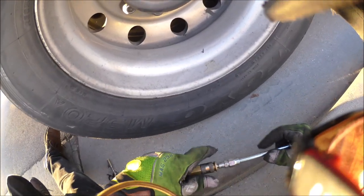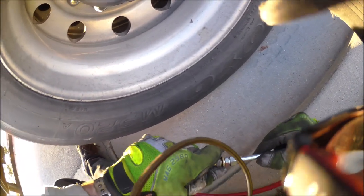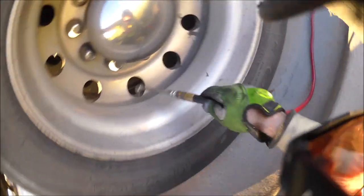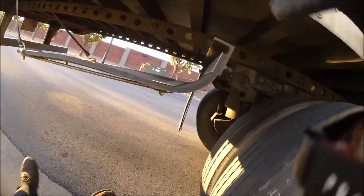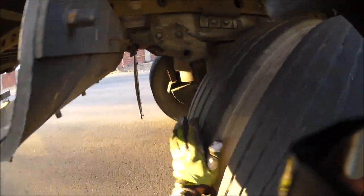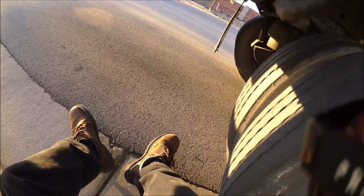I'm going to make sure this chuck here is really working because the air leaks out once I put it in. The main thing is I'm putting air in - I usually put about 30 up to 50, no more for the first half hour. I do that so the bead doesn't get broken when you have no air - it's really hard.